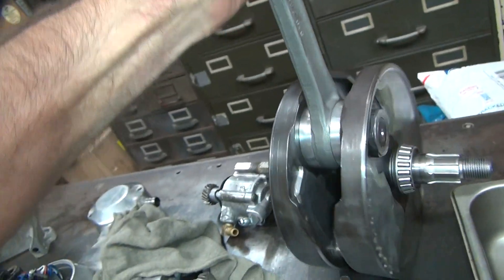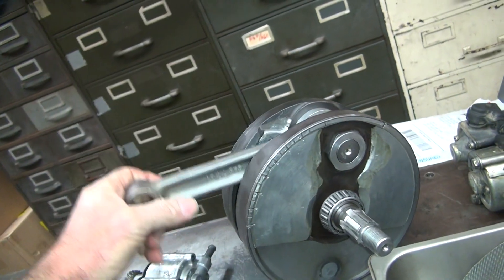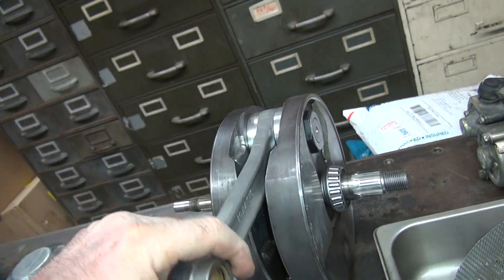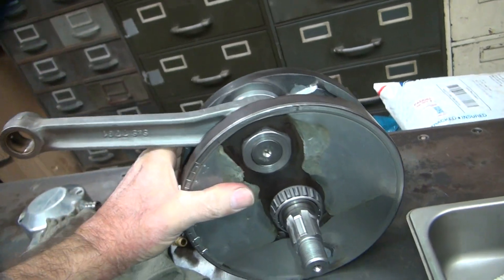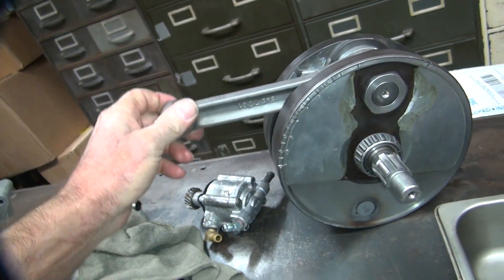Something I've learned after a few years of racing is that if you want your rod bearings to spin and not slide at high RPM, you better loosen these rods up. I run anywhere from two and a half to three and a half thou dial clearance, depending on what mood I'm in. The bearings roll and don't skid and tear up the crank pin.